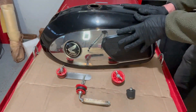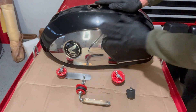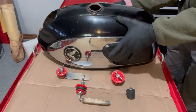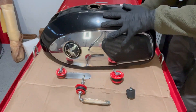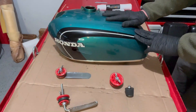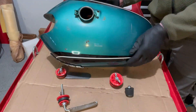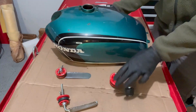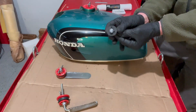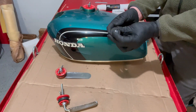This 1965 to 1967 bomber tank on the other hand has got a lot of volume, so I'm going to want to get my anode in very deep. It also has a very small filler hole, so again the 40mm plug works well for that. The 71 to 73 CB350 tanks on the other hand have a very large filler, so the 50mm plug will work well for that. And for the smaller tanks I simply use the 35mm plug — it works well for the older CBs.